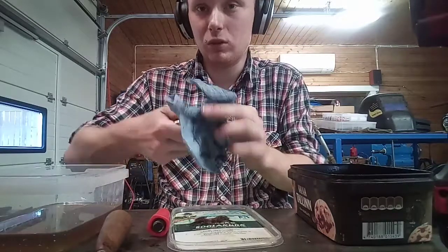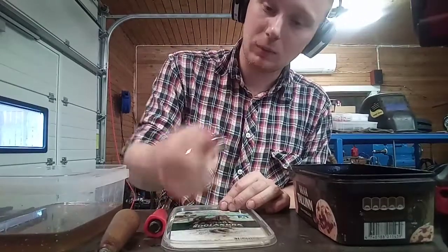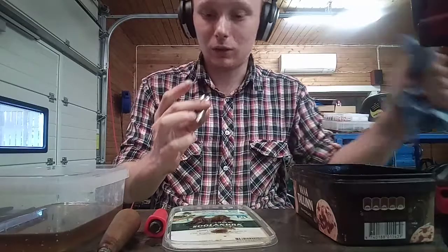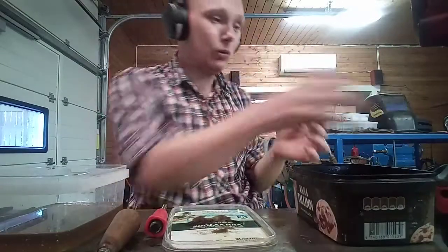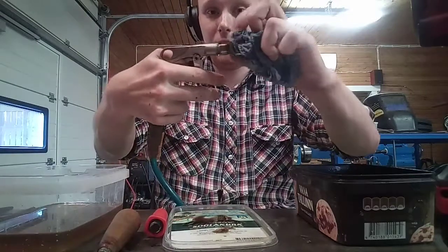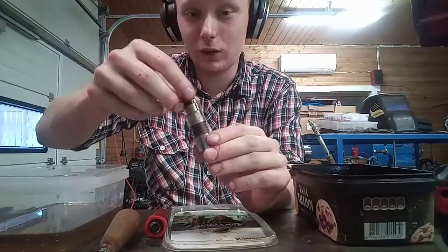Getting out the piston, which moves inside here — sometimes they come out easily and sometimes not. You hit them like this a few times and they start coming out. My preferred method is to hit it a few times so it comes slightly out, then take a piece of paper, take the air gun, put the head of the air gun in here, and with a small burst of air it pushes the piston out.